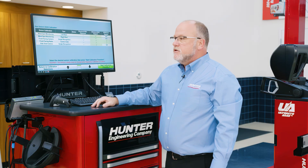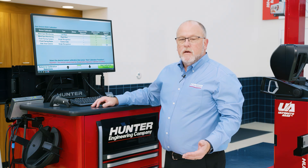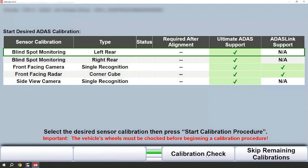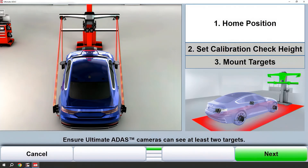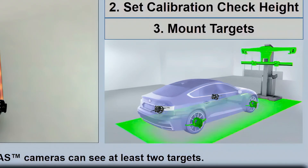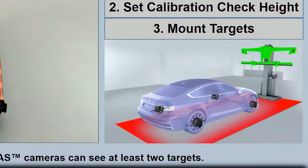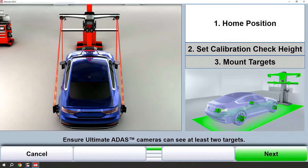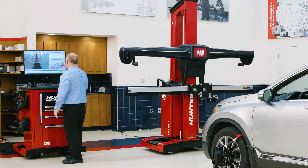Now that we've returned to the start calibration screen, let's talk about something important. Every morning you will be prompted to do an ADAS gimbal calibration check — let's go ahead and walk through that so you're familiar with it. Dropping down one row of keys you'll see a calibration check; simply click that. Our first step is determining home position. Take note of the camera beam and floor plane on-screen graphics. These will go through a progression from red to yellow to green as wheel targets are acquired and the floor plane is calculated. You may see this progression at different times when moving the sensor tower or blocking camera sight. Should this happen, allow the system to reacquire target vision and recalculate the floor plane to green before continuing. Regarding home position, always follow the on-screen instructions and graphics to ensure that you're in the proper location. Ultimate ADAS will go to its calibration check height.